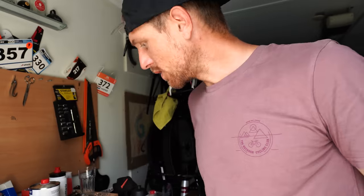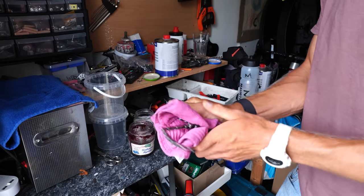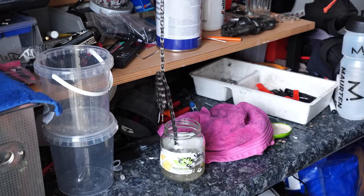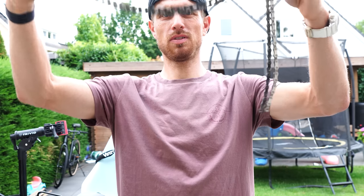The big test: a brand new Shimano chain — the worst thing you can do is ride it just like that. You can see how dirty the solvent is after just one round — one time is not enough. Nitro Thinner is used to clean paintbrushes and such, and it's actually a lot cheaper than regular chain degreaser but way more effective. One thing when working with aggressive solvents like brake cleaner and Nitro Thinner is to be mindful of ventilation — best to do it outside or with an open window nearby. With a new Shimano chain, two rounds of shaking it in a jar gets a pretty good result; a third time makes it perfect. Three times in Nitro solvent and you will have a perfectly degreased chain.